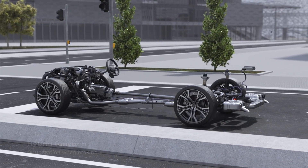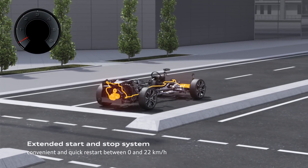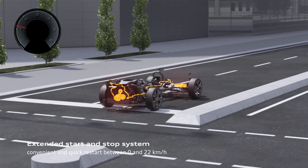When you're stopped at a light, the stop-start feature will use the front camera to predictively restart the engine as soon as the vehicle ahead starts moving. Decoupling the engine from the transmission has been around for years, but the biggest change in the Audi A7 Sportback and the A8 is that you can disengage the engine and shut it down for a full 40 seconds.